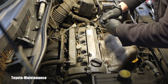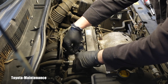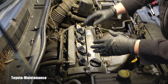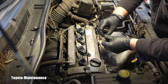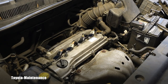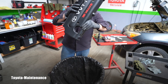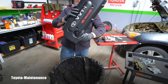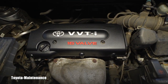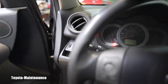Keeping the coils in the same order — purely theoretically, the ECM is used to seeing certain data from certain cylinders and you don't want to mix and match the coils, as slight variation could trigger misfires. Now cleaning the engine cover — it's a sponge full of oil. Way, way better after cleaning.